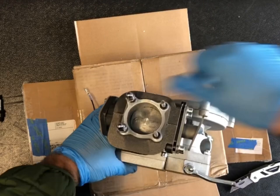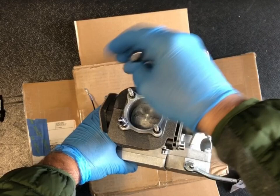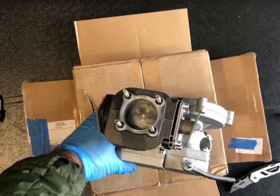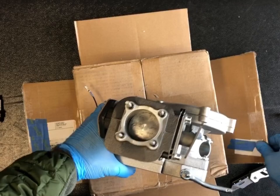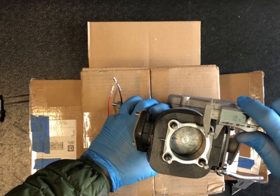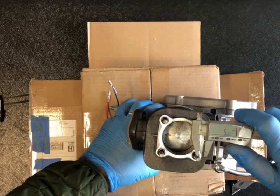You've probably seen this engine, which means you've probably also seen the price tag of close to $500 just for the conversion. Like I said, this is not a conversion — this is a hybrid. Inside you're going to have a 47 millimeter piston with two rings on it. It's also going to be a windowed, double-slot windowed piston, in effect for the reed valve. The transfer ports are split and able to deliver quick breathability to the engine.